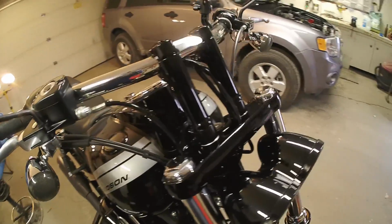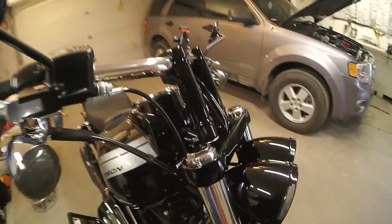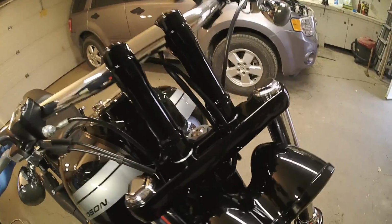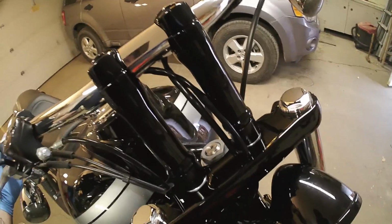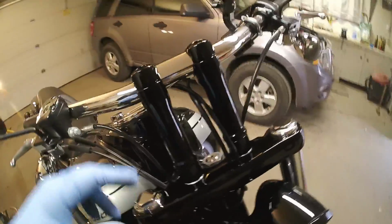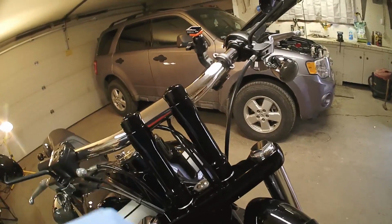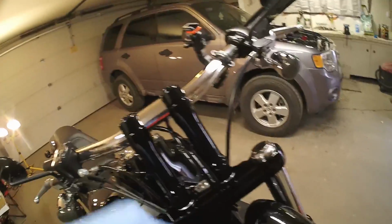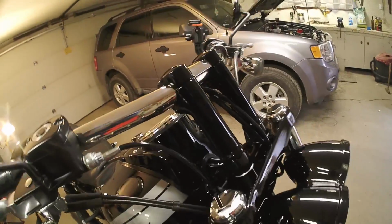Again, this is something that comes from feel. For you older subs of mine, if you remember doing the front bearings on your 2-wheel drive S10s and your C10s and even your old Fords, or even if you own a boat trailer, it's that same style. Instead of using that nut and touching it down, spinning the rotor, backing it off, touching it down, and putting the cotter pin in, now you're tightening this little star wheel until you feel it, until it's just there.